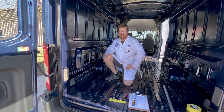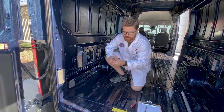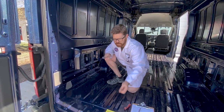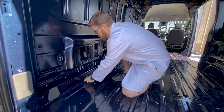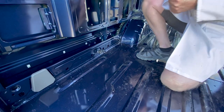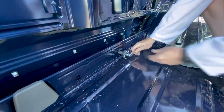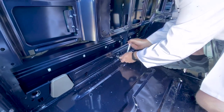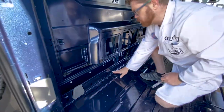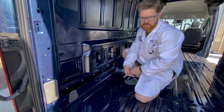For our next steps, we're going to pull out our factory tie-downs as well as these rear door catches. For that we're going to need a wrench, a 13mm socket, and a T40 — whether it's on an Allen key or on a socket. All the factory tie-downs are going to be throughout the van, usually around 8 to 10. We just use our 13mm socket and pull them out. Our floor system comes really close to this height, so we want these out of here, and our wall system is covering these anyway.